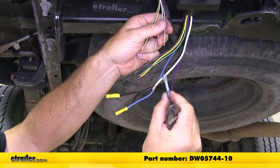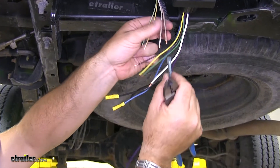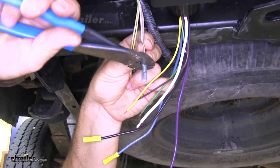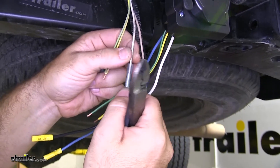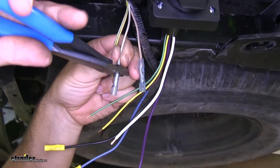These don't come in the kit, but you can find them on our website. I'm just replacing the existing ones because these are going to be living outside. For these heat shrink butt connectors, we're just going to provide a little bit more protection from any corrosion, any moisture, anything getting to the wires.